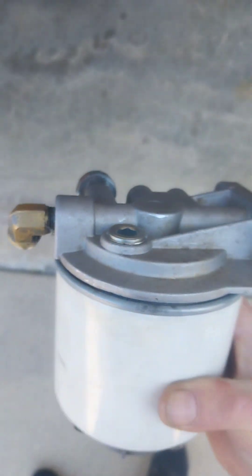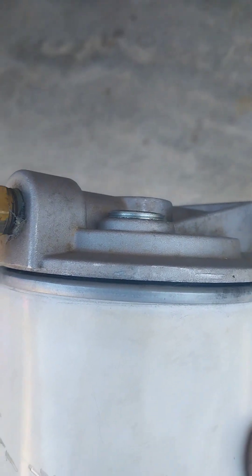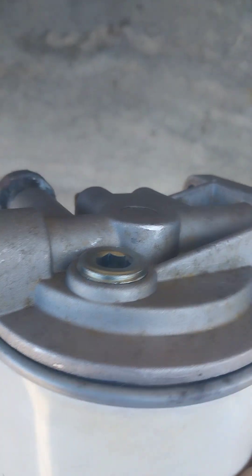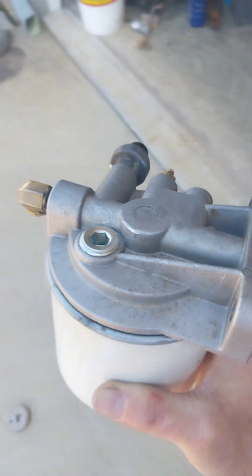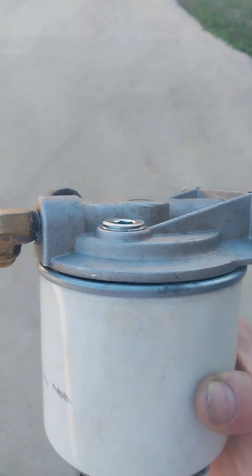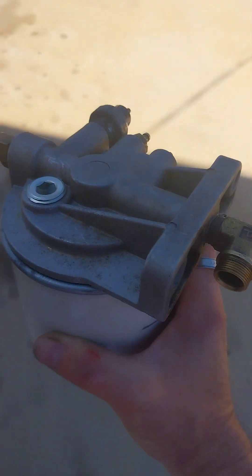Turn a few times and back off until you get about halfway down. Because you don't want to thread it all the way through — you don't want your nipple to go all the way through. You want it to stop eventually. So that's the classic diesel fuel heater delete. That's all it is. That's pretty cool. Now you can cut that wire off.